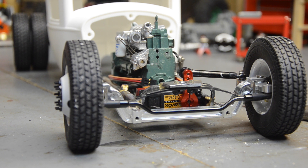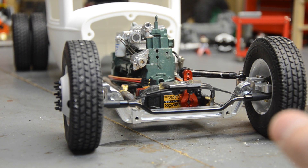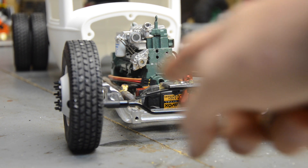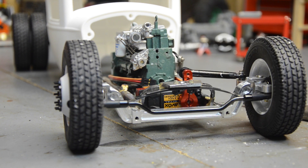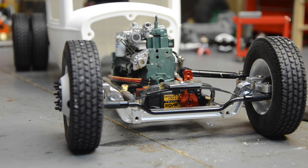His axle is custom made, it's much wider. And he bought the short wheelbase TF2 leaf springs which are, with the eyelets, about as long as what we have here. So even that being shorter is still not going to give me the room between the drop angles to allow for it to fully function. So the shackle idea is out the window.